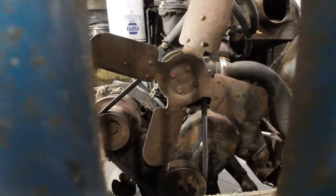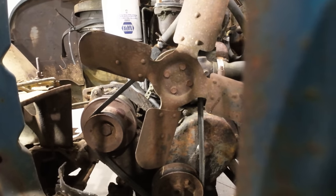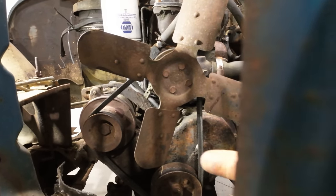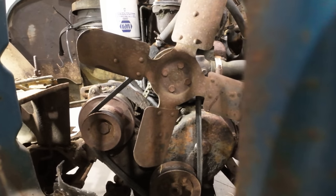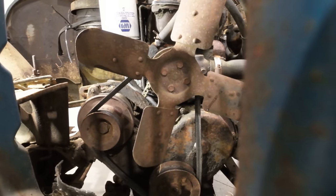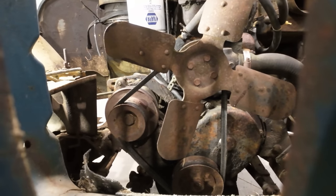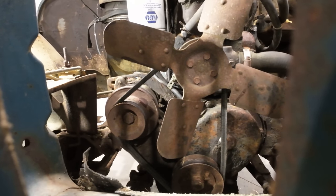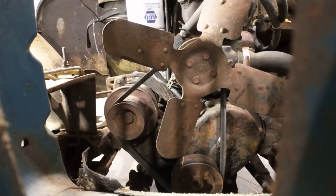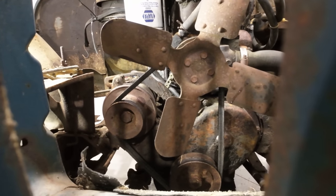Well, in typical fashion here, I'm having a peek through the old front grill, and if you can see the fan belt there, she's pretty dry rotted, cracked up and whatnot. So while the radiator's out, it's a really good convenient time to change that over. And also, it's got the old generator on the side here rather than a modern alternator, and I'm giving half a thought to yanking that thing off of there and just putting a 12 volt one wire alternator on there. I think I have one laying around here, so